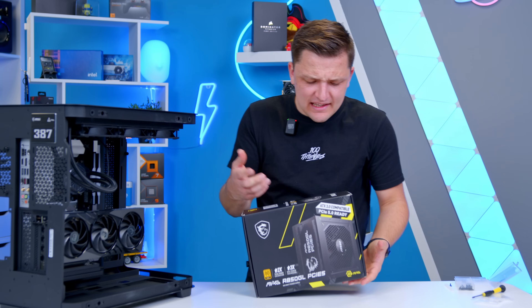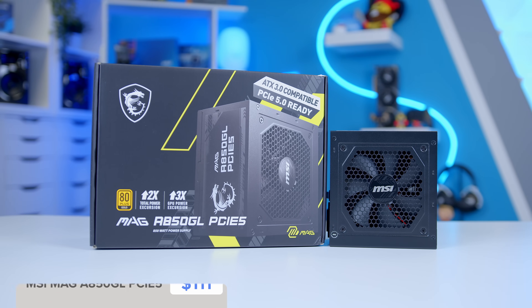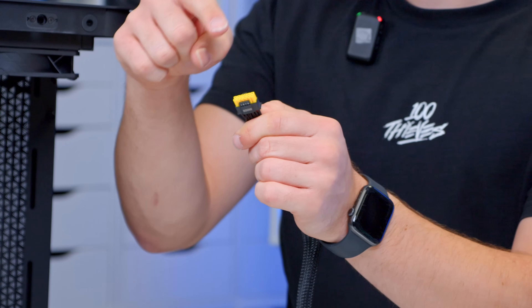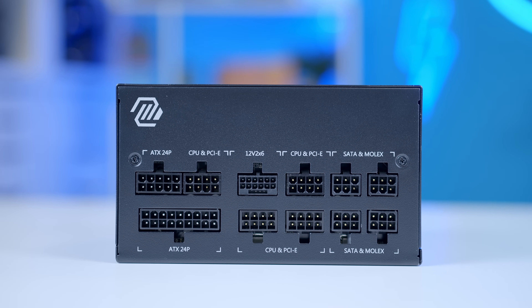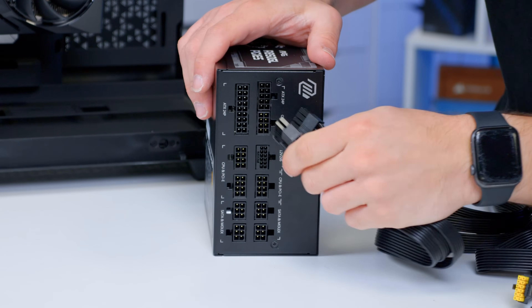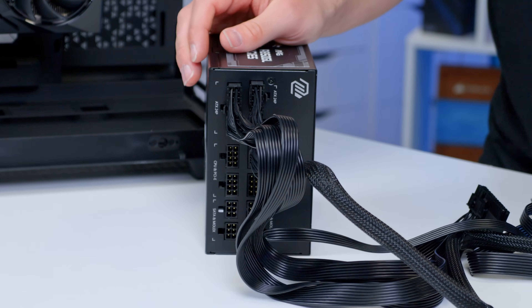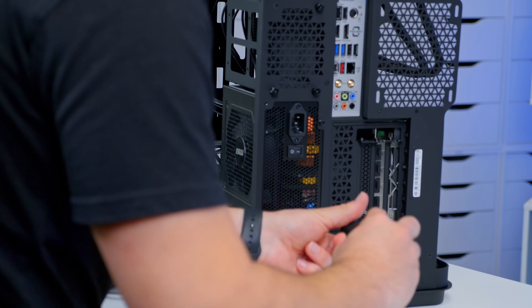All that remains is the power supply, which should be easier in this build — but it's quite a big thing: do the zero cables really, genuinely make things easier? I guess now is the time to find out. MSI sent this and the other bits out at my request for this build, and I have to say MSI are putting together some really cool stuff at the moment — little innovations like a yellow PCI connector, so if any colour is poking through you can see the cable isn't seated properly. This is a modular unit, so you only plug in the cables you actually need. You'll need a motherboard power cable, two CPU power cables, and a PCI Gen 5 cable. I always like to add a SATA power cable in too, even without SATA drives, as lots of RGB accessories use these. Don't throw away any spare cables — finding replacements isn't always easy.